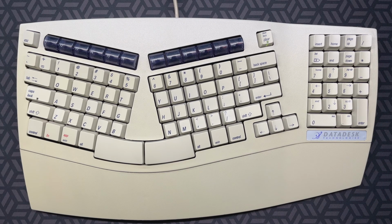There are just a couple of minor issues with this keyboard. First, the stabilizers rattle, especially on that split spacebar. Second, other than the mounting plate, the keyboard is plastic, and there's a lot of empty space. This means that the keyboard is loud and sounds hollow. I suppose I could mod it by filling the empty space with silicone, but I never got around to trying that.